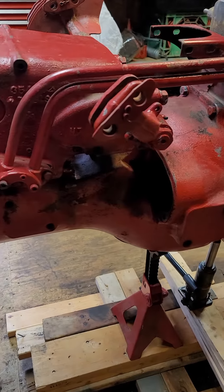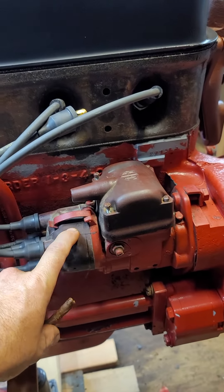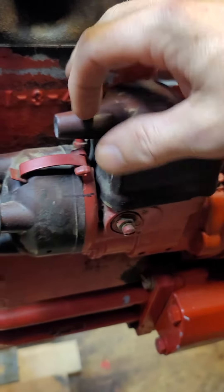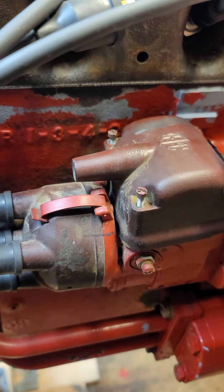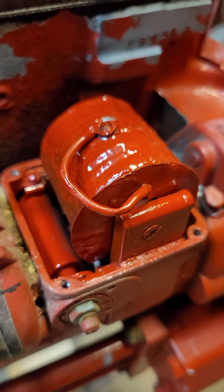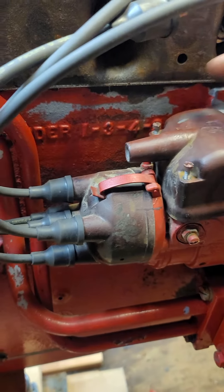As you can see, it is pretty much gutted. The last thing I need to do is rebuild the magneto on it. The magneto was actually bypassed and it had the external coil run in place of it. Once I got the cover off, I realized that the previous owner had sprayed everything inside of it. So obviously the magneto is going to come off and get completely rebuilt. There will be videos on that to follow.